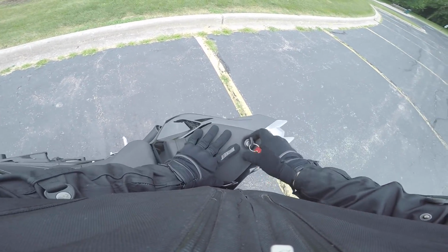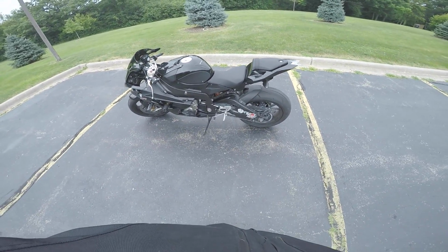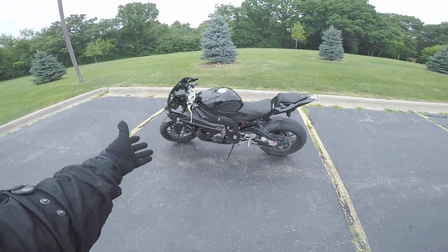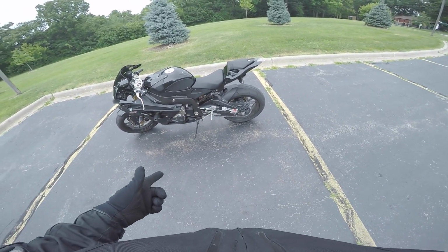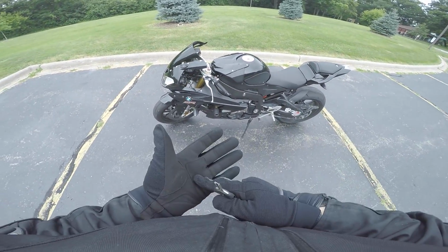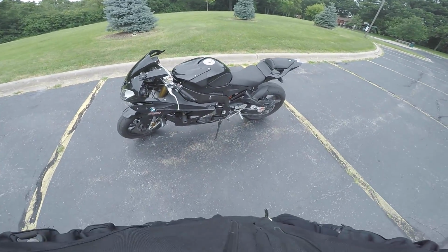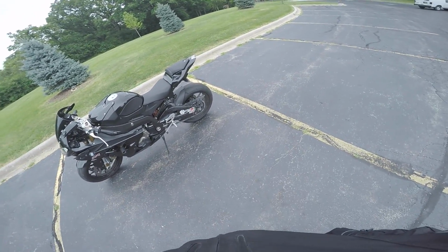Now I know some of you might have a question of, well, if it's not dyno tuned, how do they know how to tune it? Well, basically they have an in-house dyno, a double R. So they dynoed it with all the upgrades that they tell you to do, and they get the air fuel ratios, their timing tables, all that good stuff down, and then they are able to send you kind of like a base map off of their testing. Damn, those wheels are dirty.